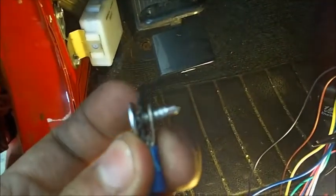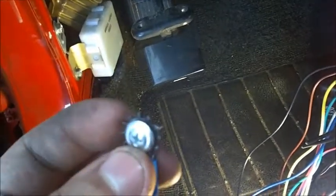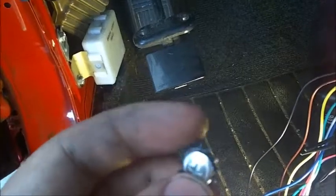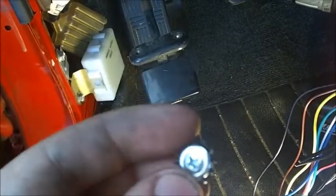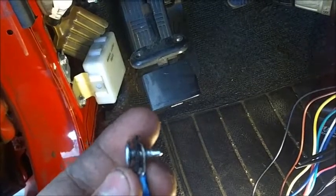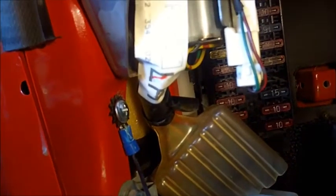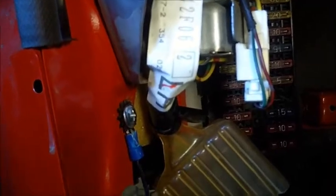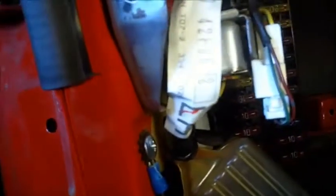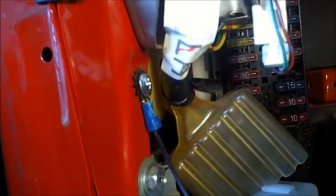Now I'm going to go ahead and screw it in. I also have a star washer on my self-tapping screw — the end is cut for self-tapping. You can go to a hardware store and ask for self-tapping screws. The star washer is there so it doesn't end up backing out. Some guys like to sandwich it, but these are painted so I won't be doing that. If they're plain silver star washers I'd usually sandwich them in — it bites into the metal a little bit better. Now you can see there's my ground: paint scraped, star washer on there, the terminal is touching the metal.